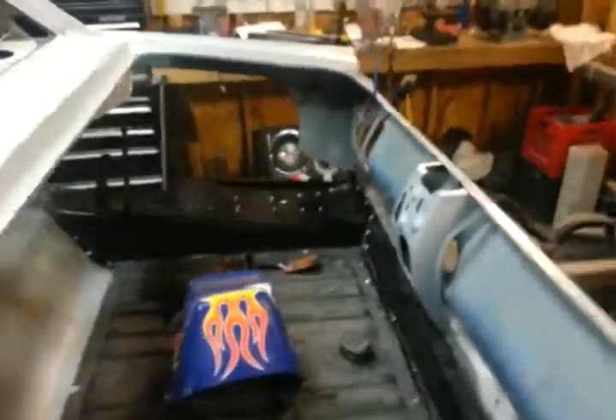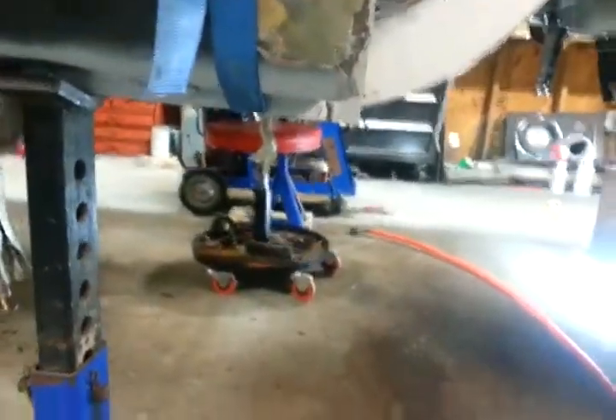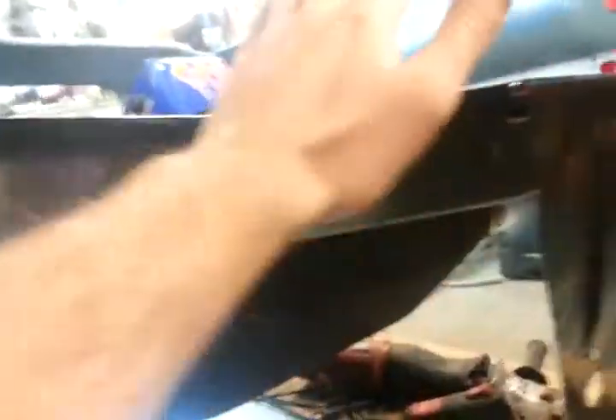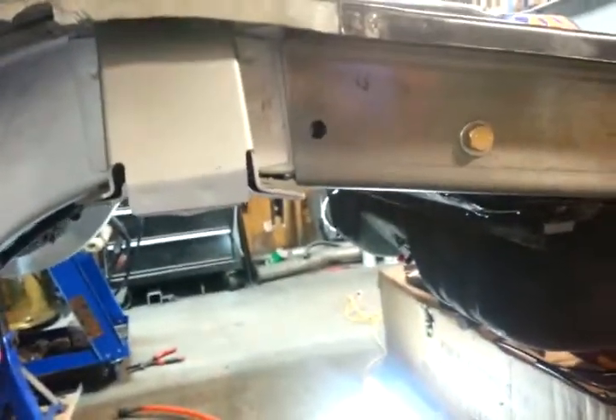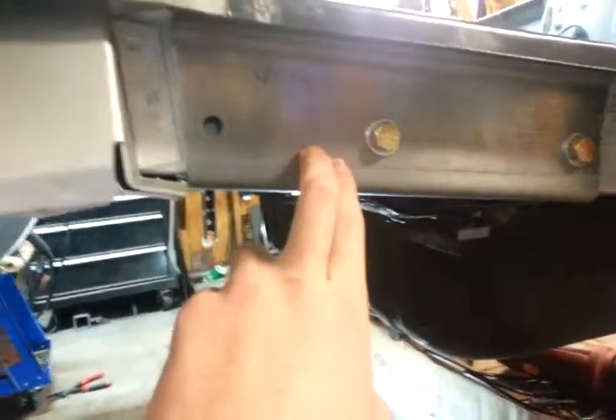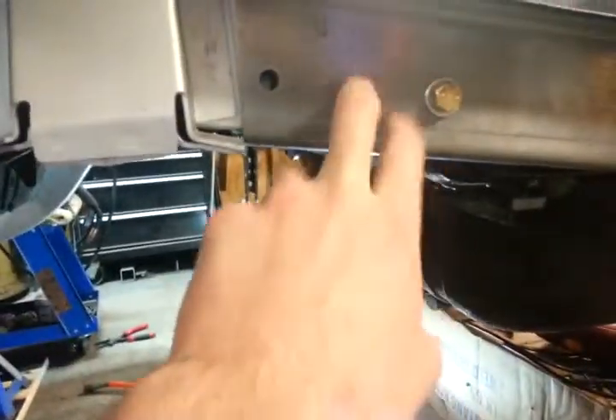Now that's in and I've got everything welded minus the other side. I'm going to finish up welding that tomorrow — just kind of burned out right now. I've got the car lifted at the appropriate height for the baseline so I can get all my measurements straight. Once I get that other side welded, I'll start knocking these off because these have to come off for that frame piece. I'll take my measurements and at least mark these frames. I had to get this back section welded because once I cut it, there's not going to be anything to keep the back section of the frame in place once I cut out this section, because that other frame piece is a weld and pretty much replaces this section completely. I know I'll have to modify either these or the frame rails over there on the bench because they do not fit inside of these little sleeves.